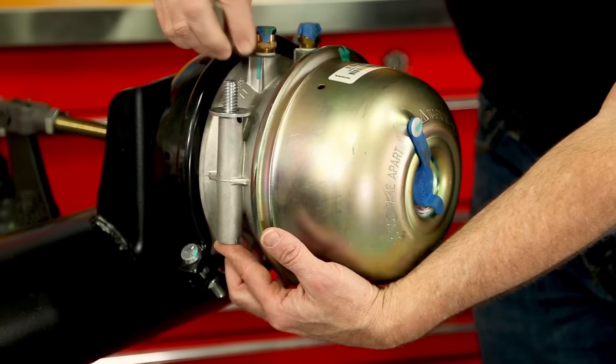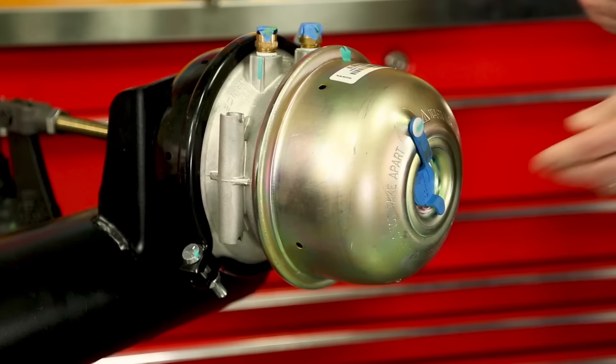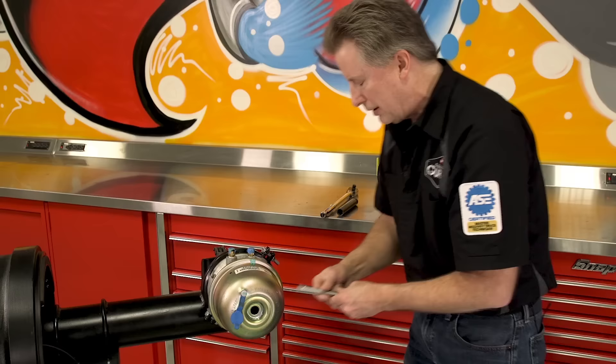The first thing I want to do is remove the caging bolt that's here in a storage pocket on the side of the brake chamber. Now this bolt has tabs on it and these tabs need to be inserted into the brake chamber. I'm going to pull the weather seal off, and you need to insert this bolt inside the chamber into the end of the center shaft until it comes in contact, and then you can lock it in.